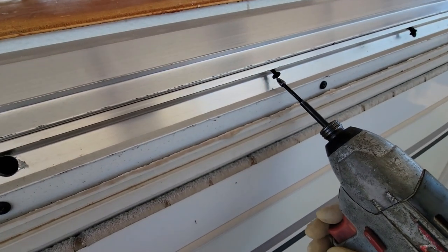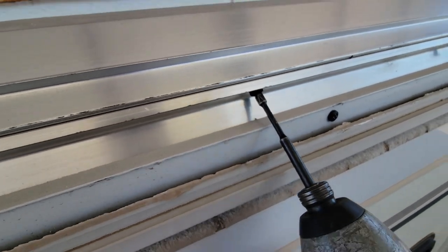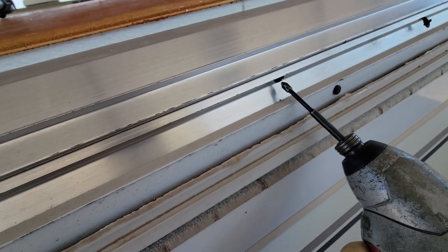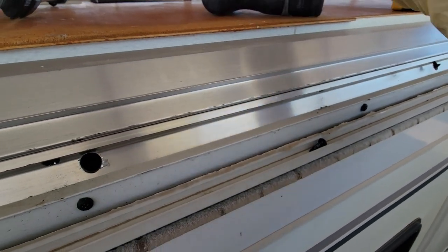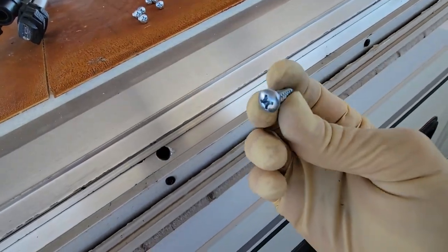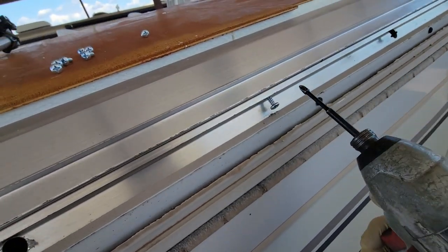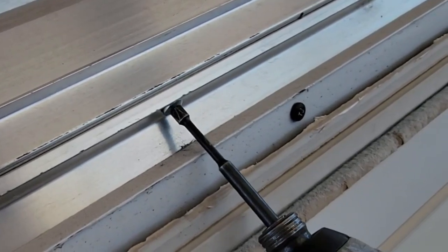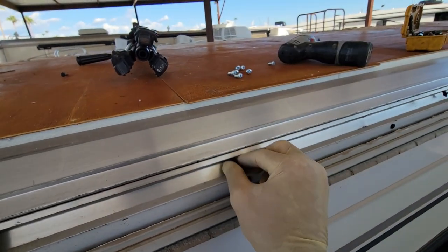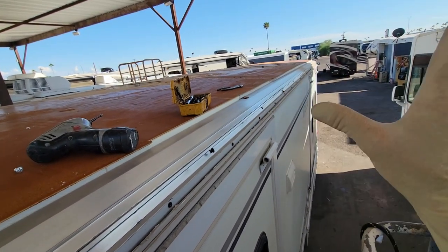Now, even though I think I could tighten these screws up, these strip out, and they're all loose for a reason. So I'm gonna go ahead and replace these with a little bit bigger screw. Besides, these are really useful screws for me to keep. In this place, I'll just be using these number 12, 3/4 inch long screws. They are exterior grade, I guess. They're just wood screws. So I'll be replacing all of these on both sides, because that could also be a problem if the roof was very loose and flopping about too.